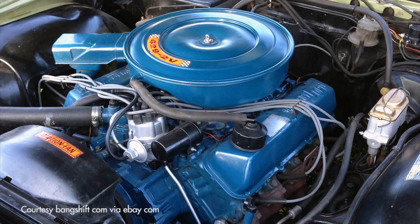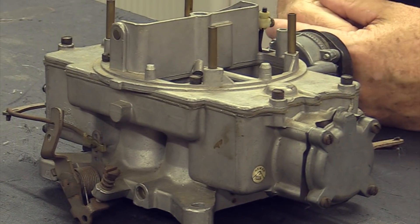I have to believe that some of the larger venturi sizes are probably for truck applications like F-700 and above. I can't swear to that, but they were still using these on 429s and possibly 460s, and maybe 370s. If you have information on that, fire it away — let me know in the comments below.